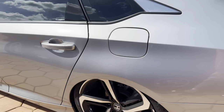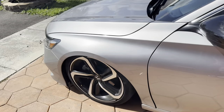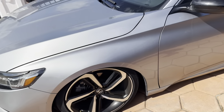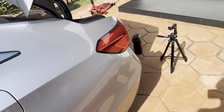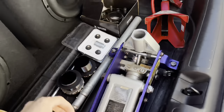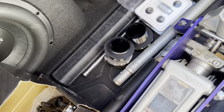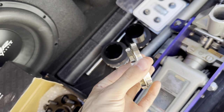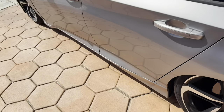You see the fucking tuck in the back. Right now we're sitting on some BC Extreme Lows. We got them maxed out. So the reason I'm tucking in the back is because I took out the boots from the back with the locking rings. And then on the front, I also took off two locking rings, one from each side. So that's how we're sitting this low.